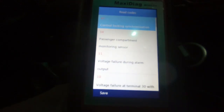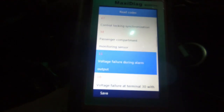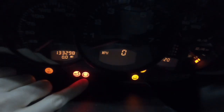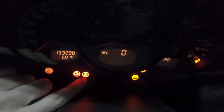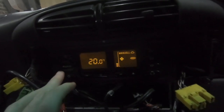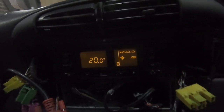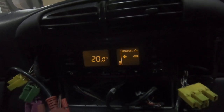The alarm system has been showing a fault since day one, but it's not the end of the world. I have a problem with the central locking — it's a pain. I've disconnected some of the passenger compartment sensors. So checking a couple of the warning lights: this one's actually the brake pad wear sensor, which I've replaced on all the brakes I've updated so far but haven't actually plugged in, so it makes sense that it's showing up. The climate control is kind of working, though if I start trying to use the air con it probably won't work well because the air con compressor isn't being spun.